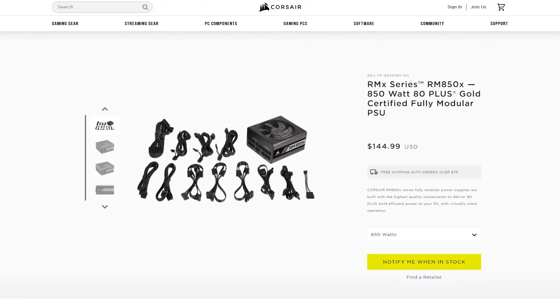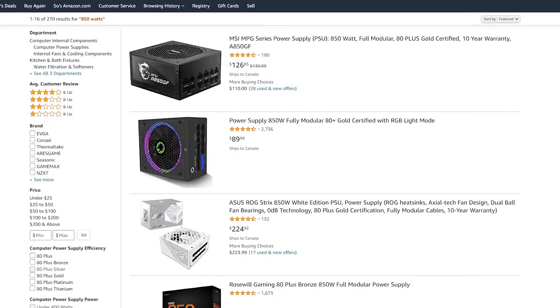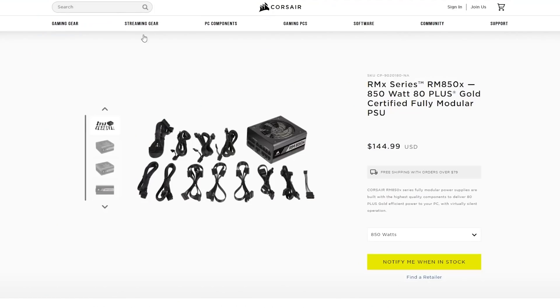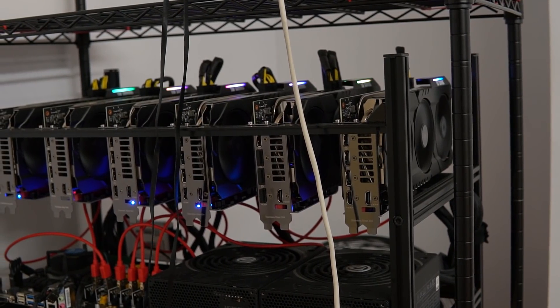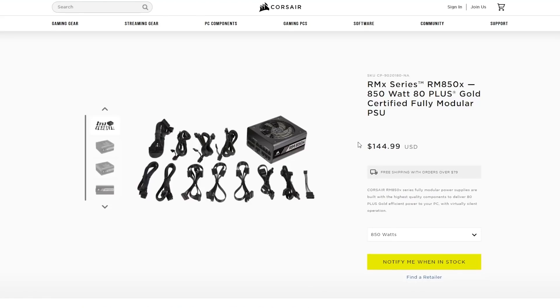You don't really need to always go for the Corsair brand — if you want to go for any other 850 watt power supply it's also completely fine. One of the best pros about these power supplies is you can grab more than one if you need to expand your GPUs later. You can start with one for 3 GPUs and then once you get 3 more, buy another one and use a power supply splitter to run 2 power supplies in the same rig. The con of that is you'll need to use 2 wall outlets. If you're looking for adapters such as the CPU to GPU splitter or the power supply splitters, you'll find them in the descriptions below.